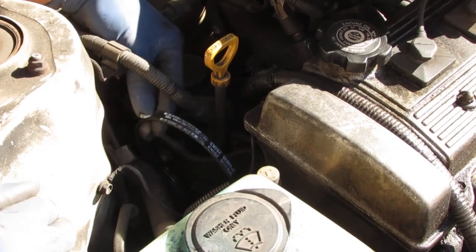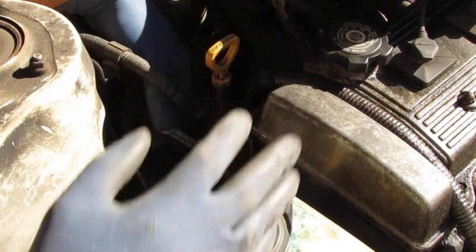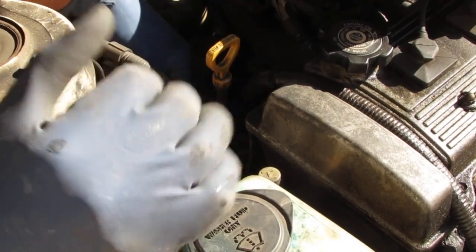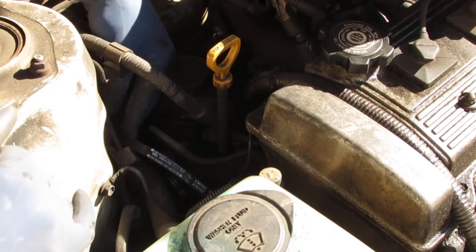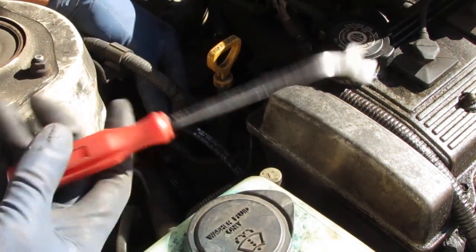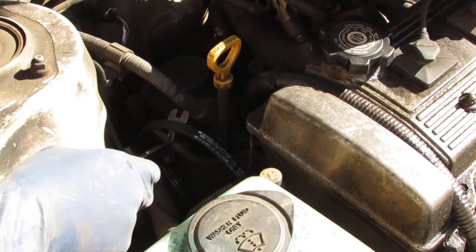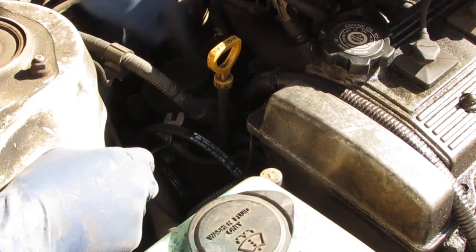I'm going to show you what I did to isolate this. Now the pump is not going to turn anymore, so it's not going to generate any pressure because it's not getting any assistance from the crank. With this isolated, you can now test to see what it sounds like when we turn the car left and right, and that isolates this pump by itself.